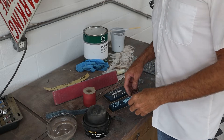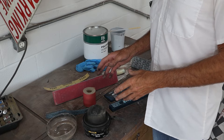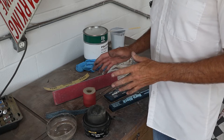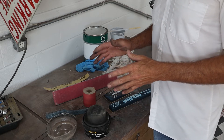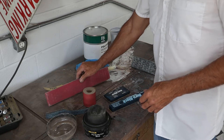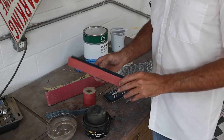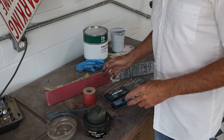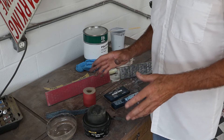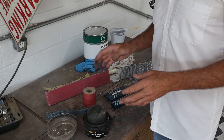Okay, what we're going to be using today — we're back on 240 grit because we're still straightening the fenders and making sure there's no waves or anything like that. We've got the longboard there, we've got a shorter one, and I've got my flexible Dura-Blocks. So we'll go over the fenders all over with 240 and see how well our bodywork and filler work came out.